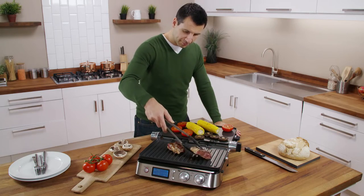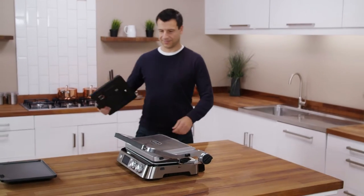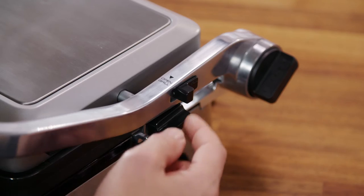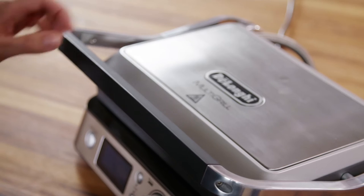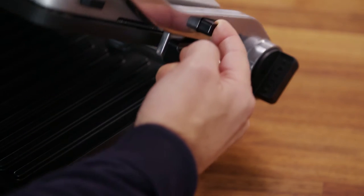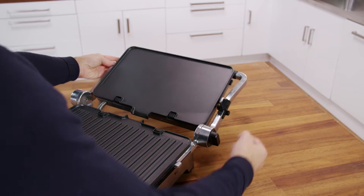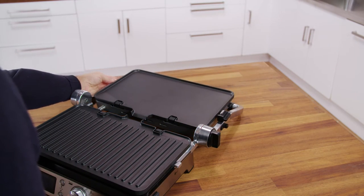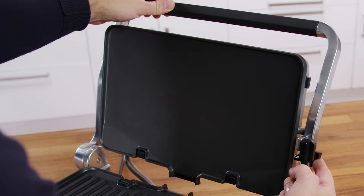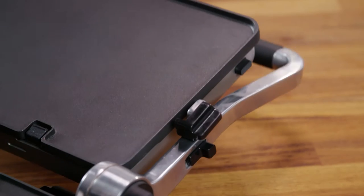In this position, you need to turn the food during cooking. To place the appliance in this position, first find the hinge release lever on the right, hold the handgrip with the left hand and with the right slide the release lever upwards. Push the handgrip backwards until the cover rests upside down in the flat position. Lifting the handgrip slightly before pulling the release lever lightens pressure on the hinge and helps the operation.